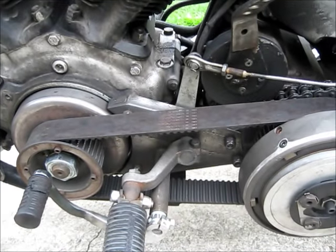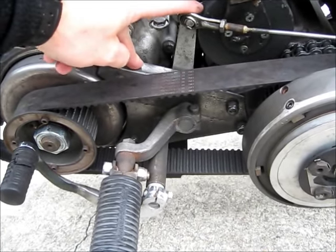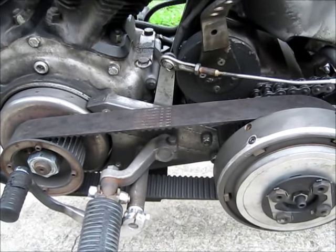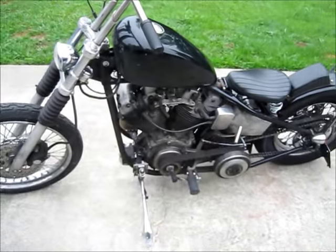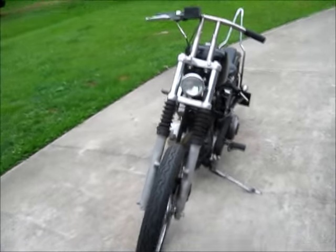This side is completely open now so I don't have that rub I had before. I made this bracket here with a hidden spring behind it to keep the weight off of the throw-out bearing, using some old Harley parts. The shifting linkage just runs through that piece of plumbing pipe welded in there. That's basically the big picture since the last video, and I'm excited to get started - hopefully this year will go a lot smoother.